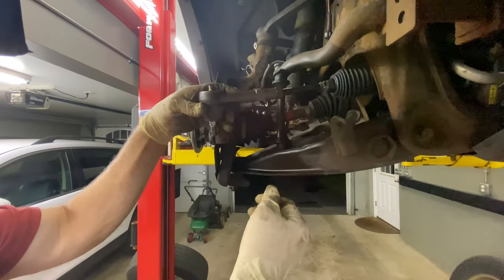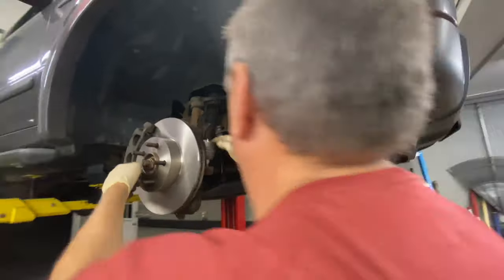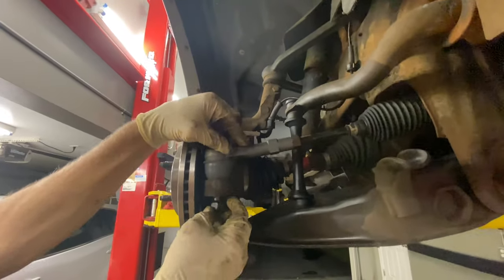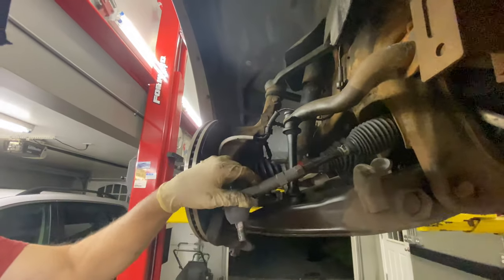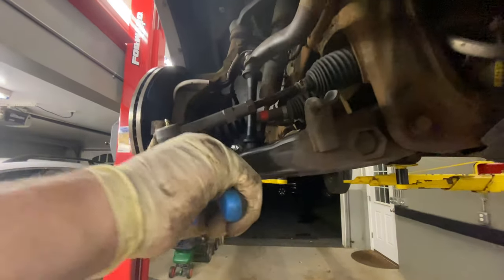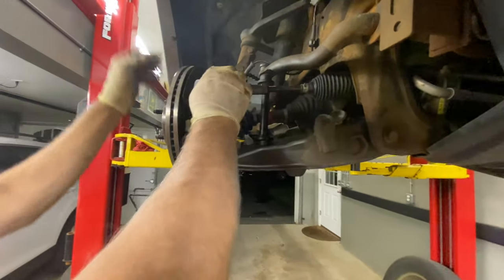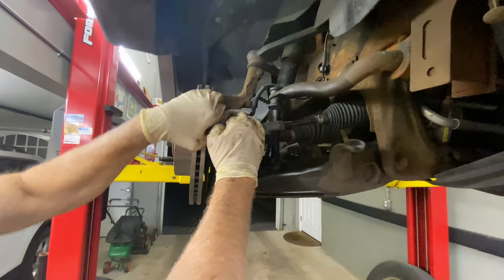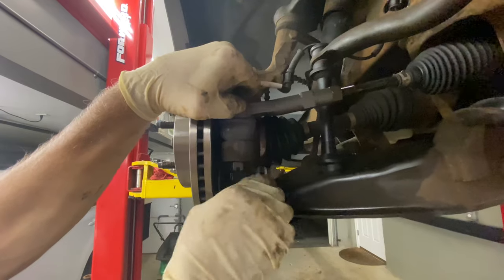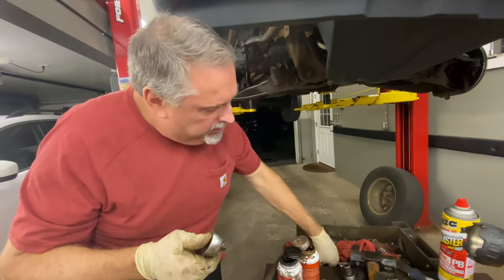This one is pretty much right there — it's tight right to the nut. We're going to put our tie rod end in now and catch the new nut. Looking at the position of the tie rod, I like to have it turned a little bit more so it goes on straighter. Don't grab the threads — grab the metal part and just rotate it a little bit. This is a 19 millimeter as well. We'll use the hand ratchet to snug this up — you don't want to over-tighten this.